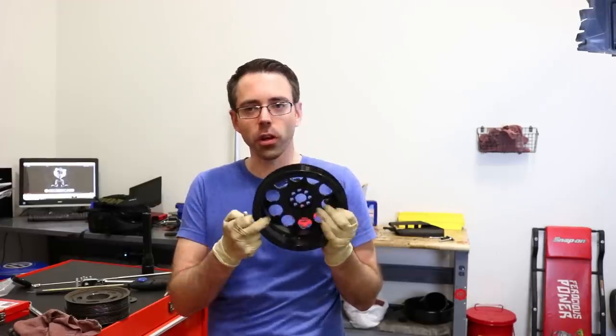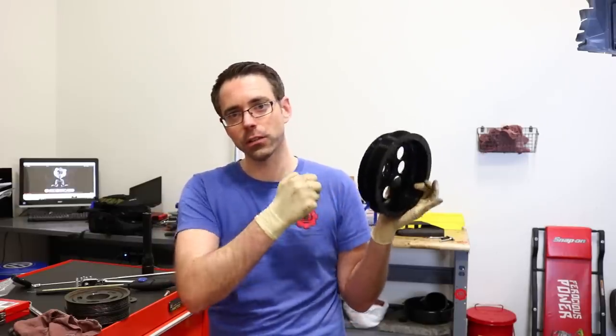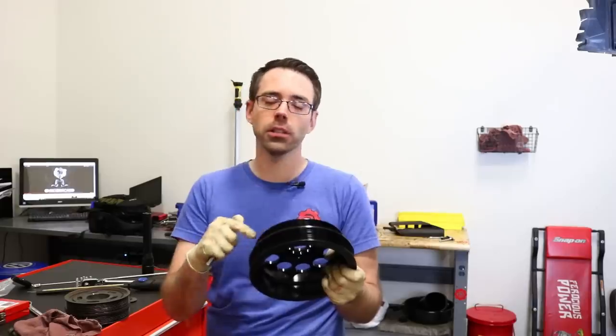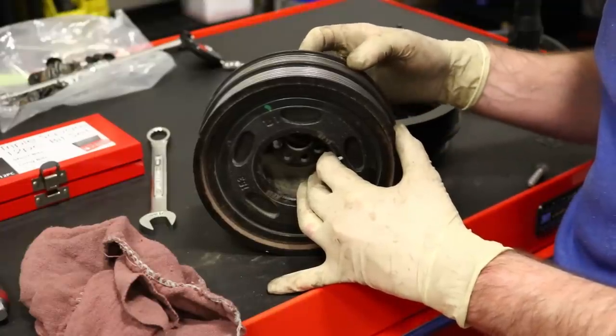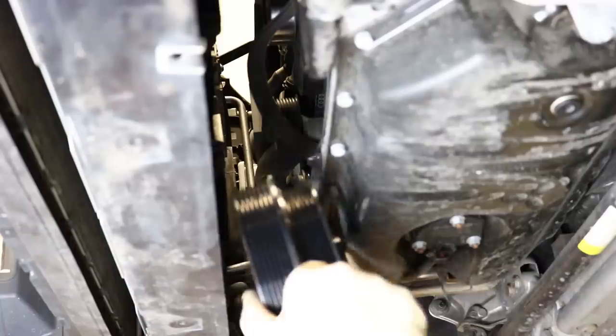What Unitronic says in their instructions is that the U from their logo should be facing in the direction of the timing mark, so we're going to install this with the U facing where our timing mark was — this should mean all the bolt holes will line up. If you can't get them to line up you can mark one of the pulleys and transfer the marks from the old one to the new one. Looking at the original crank pulley, right here is the timing mark — that's the mark you'll be lining up with the Unitronic pulley.